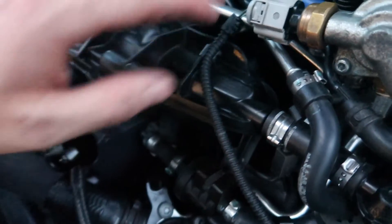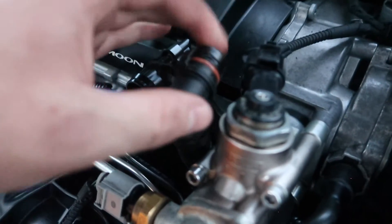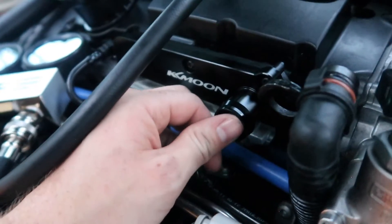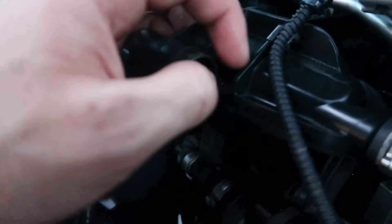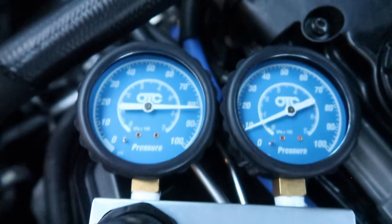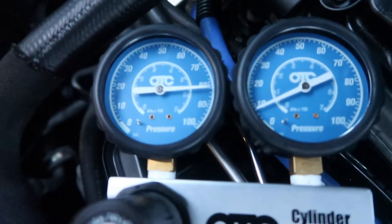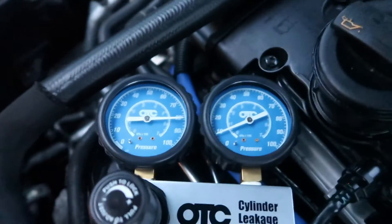Don't feel anything there. Feel a little something there. Nothing there means my piston ring is good. Nothing there. Okay, this cylinder is leaking a lot of air — the spark plug hole is leaking a lot. I can definitely hear it out the exhaust now. I can feel it out the exhaust — it's so bad. Well, let's see number two — see if number two looks the same or any better. Number two looks identical, so I'm thinking I'm just not perfectly at top dead center. Let's see — if cylinder two is good and three is bad, that definitely means that two is at top dead center, but if two is really bad then I think I'm just not at top dead center.